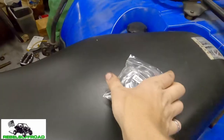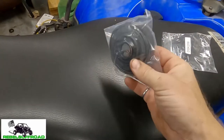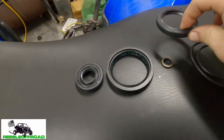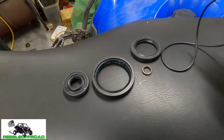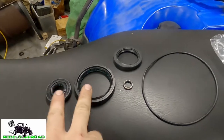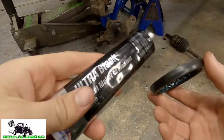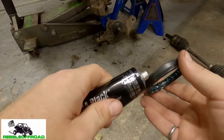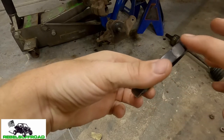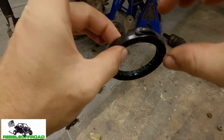I got these seals from Eastlake Axle — I'll have a link in the description to where I bought these. It basically comes with all the axle seals, including the input seal for the drive shaft. These are the two axle seals, and I think this is the input seal here. I'm not sure what some of the others go to, but these are the ones we're gonna be changing. The old seal didn't have any lubricant on the outside, so I'm gonna use some Permatex Ultra Black — it's a gasket maker. I'm gonna put a little bit on the outer edge and spread it out with my finger, getting a nice even thin film all the way around. This will help seal up the outer edge, and this Ultra Black is oil resistant.